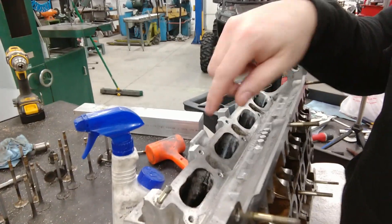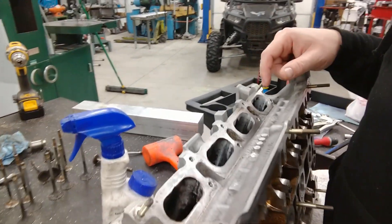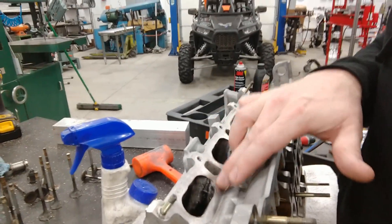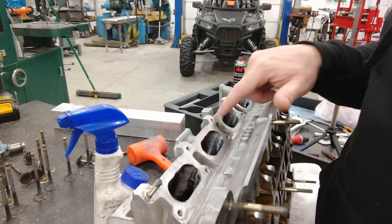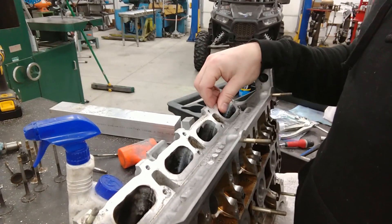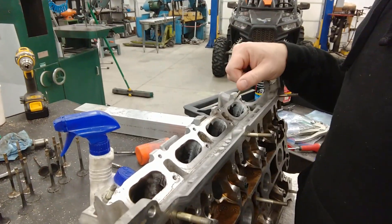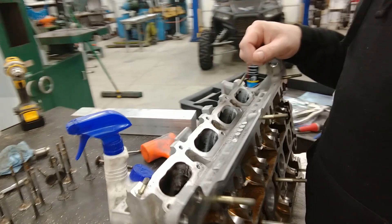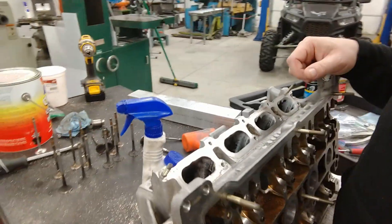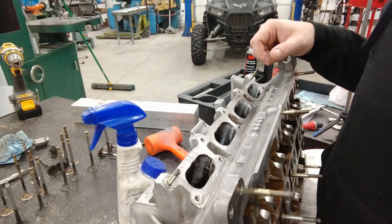So what I'm going to do is lay all this stuff out and kind of try to straighten that up. Because when I blueprinted to build intake manifolds, I did blueprint off of where the gasket sat. So if I want this port to match my intake manifolds, I need to basically bring it out to where that gasket is. It's going to be a little bit of work on these, but I think it'll be worth it in the end.